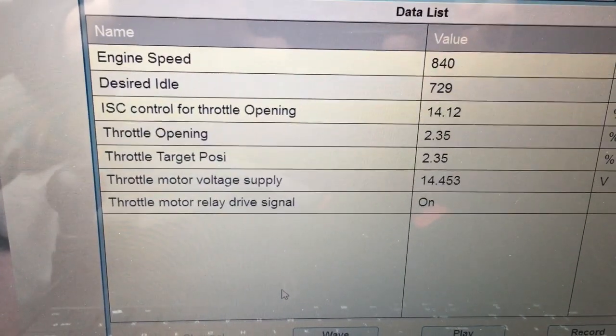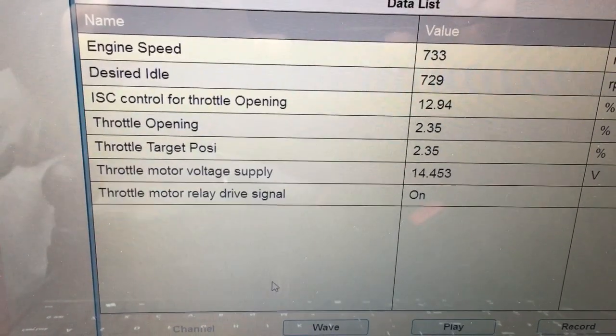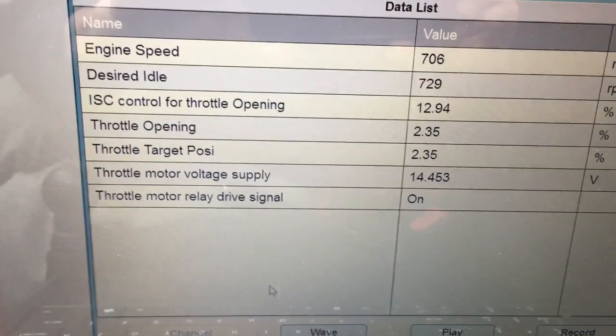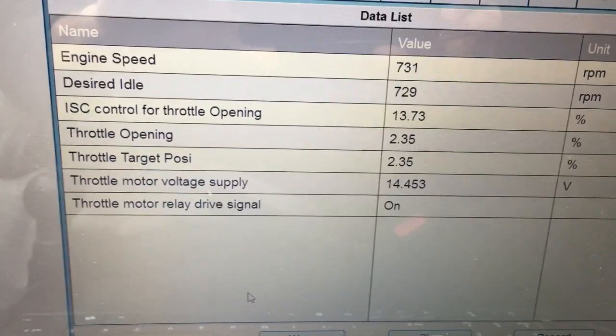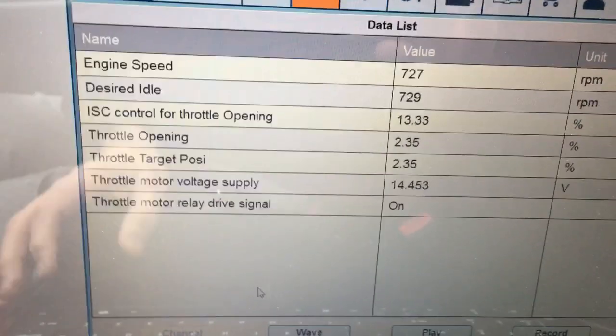It should not hang at that setting, and I'm sure it's because the calibration is off now, because effectively you have a different throttle bore now that the throttle body has actually been cleaned, and I'm quite sure that the issue is I need to actually recalibrate it. So how's that done?